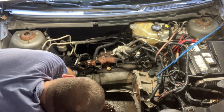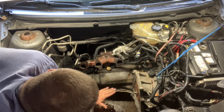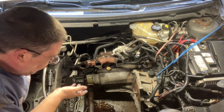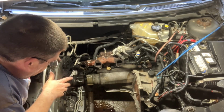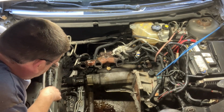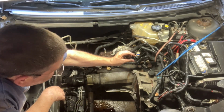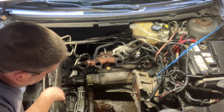Or jack it up and put something under this axle, because it's laying down and that's not giving me enough clearance to get the flywheel in. It wasn't a problem when I pulled the engine because, you know, it's coming out, so the transmission gets free, but dropping it back in, I'm about that much too far. So let me see what I can do.